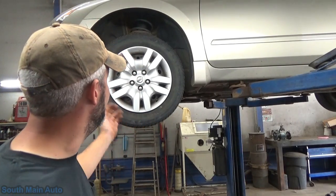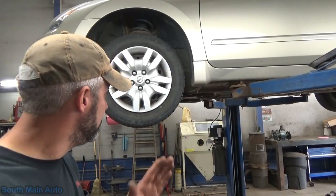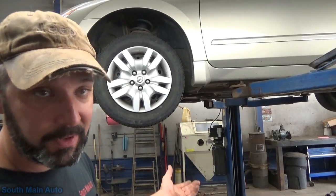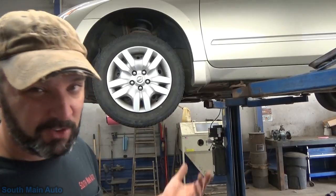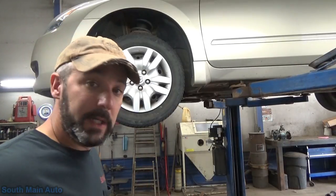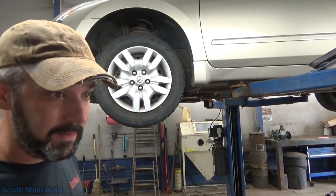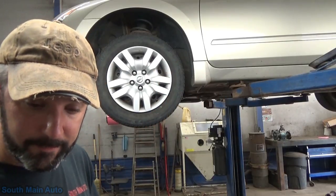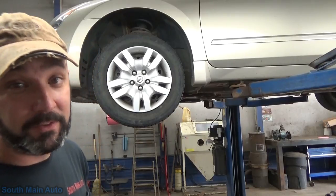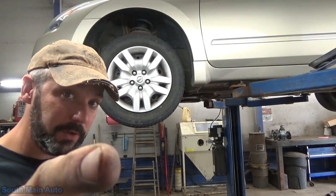And there you have it folks - the converter on the 09, maybe 08, Altima with the 2.5 liter four banger. Pretty easy, assuming you get the right parts. Would you want to do it without a torch? Probably not, at least not an old rusty one like this - because you torched the nuts off, though there are other ways to do it, you can always just cut them off and get new studs. Pretty thankful the O2 sensors came out and all that stuff. Links to the 2-inch cookie discs and thread chaser in the description box below if you're interested. I'm going to move on to the next job - see if we can find something cool to record. Find us on our socials, and just remember: if I can do it, you can do it. Thanks for watching.